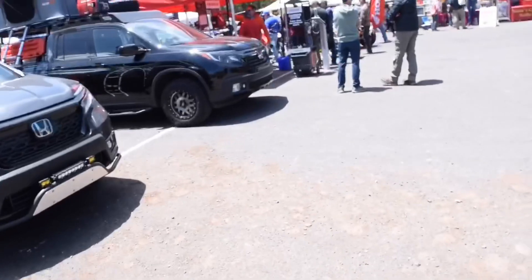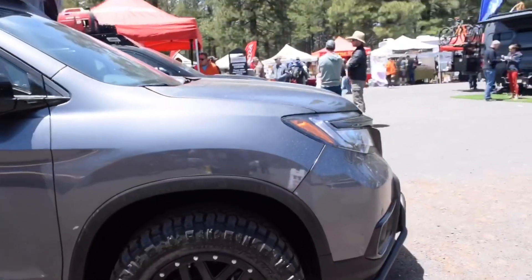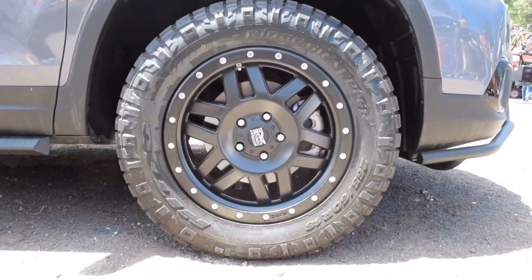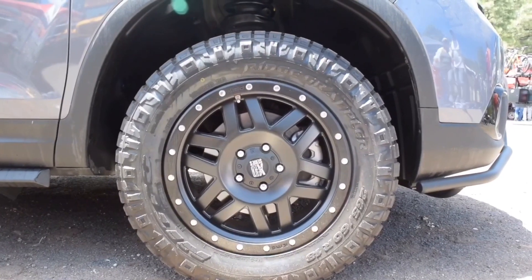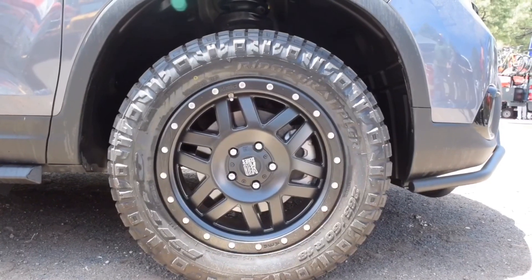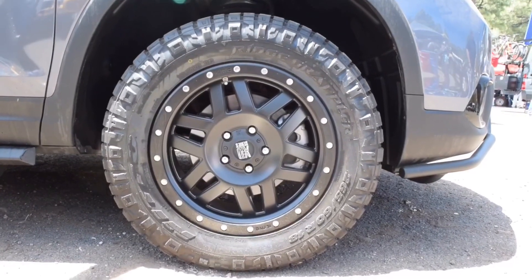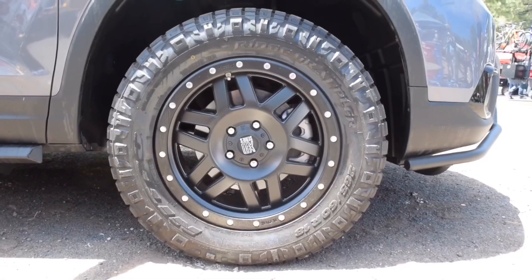Starting at the beginning, we'll show the wheel and tire setup we did on here, much like those silver cars you'll have seen. On this one we actually ran a bit of a bigger tire to see what we could get away with. These 265s do rub just ever so slightly, so we may find a different size or tire setup. We'd like to do more than the 255s. The beautiful part about the Passport is it's actually an inch taller than the Ridgeline and Pilot from stock. We went beyond that and did an inch and a half in the front and three quarters of an inch in the rear of lift. We're confident we can do at least a little bit more tire than we do on a Ridgeline or Pilot.